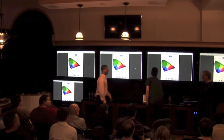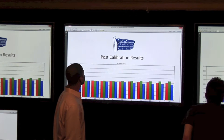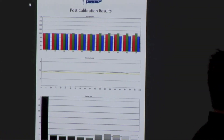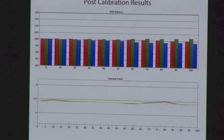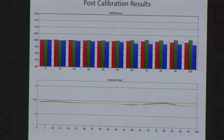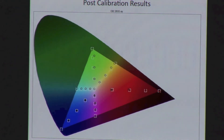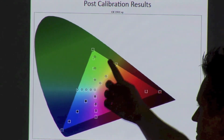We've got to do the Sony — don't leave the Sony out, just because it's 4K. Here's the Sony — it's looking real good. And that was done without a 10-point white balance because they don't have that. Does it have a CMS? No, which is frankly ridiculous. As a matter of fact, no Sony has ever had CMS — except for their SXRD projectors, and it didn't work at all. Well, they're usually pretty accurate anyway. How was the color accuracy this year? Actually good — look at that. The best. It's actually on the red — in some ways it's better than the others, except for green.